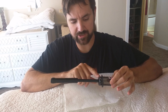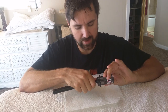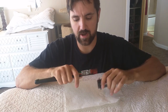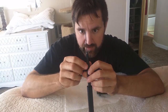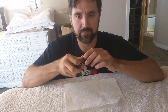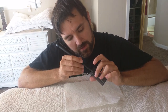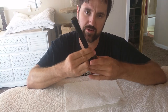First thing you're going to do is remove the retention head from the pump. Grab this portion of the pump here, twist it — it turns about 90 degrees — and then pull it off. It's got two little knocks right here and here that go into the plastic portion. When you reassemble it, push this back down, put your rod through, and line those knocks up with the slots so it goes in.